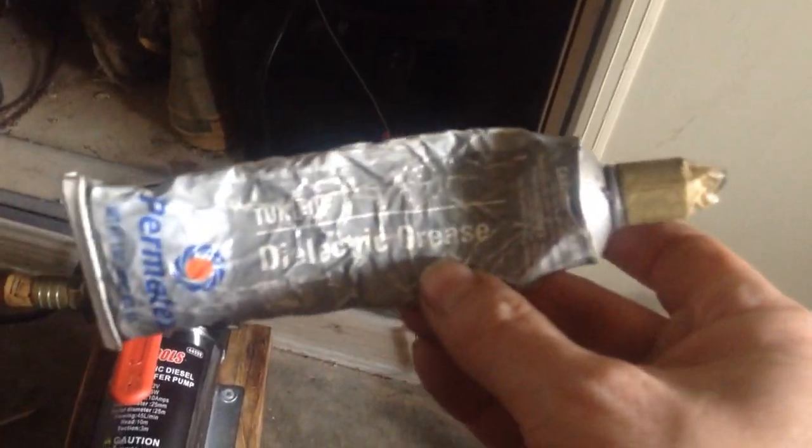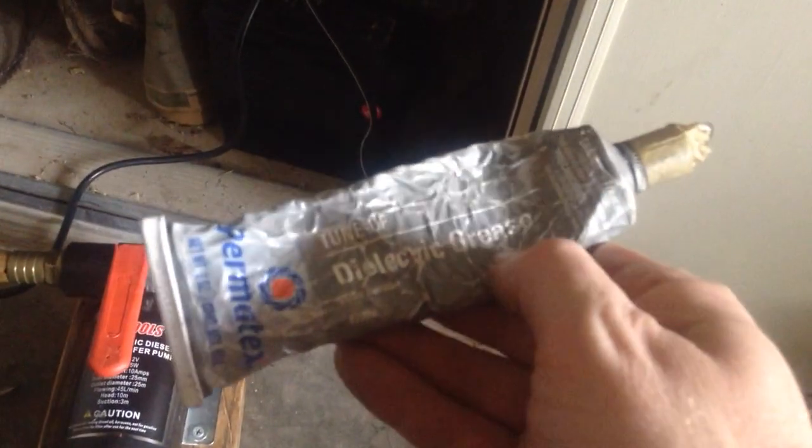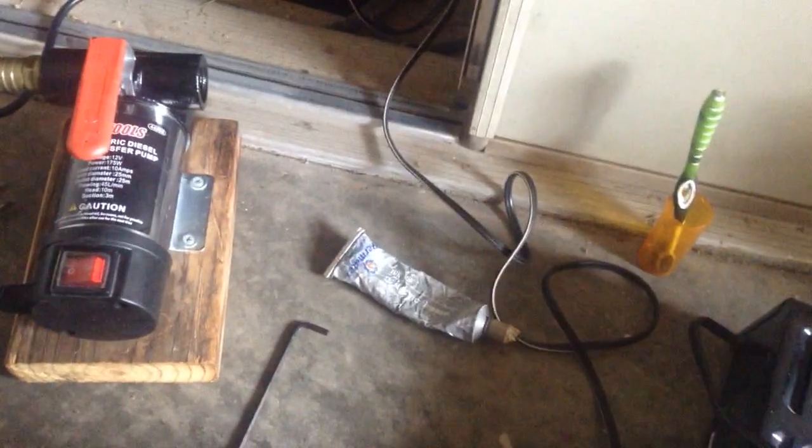It's hooked up to an old battery so it's not kicking real hard. You might also want to use a little dielectric grease — I use the high-temperature kind. I put a very light coat of it on the commutator with a toothbrush and also some on the outer steel part of the rotor, so that might help a little bit.